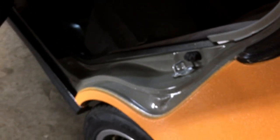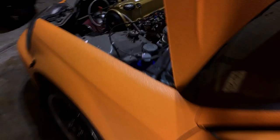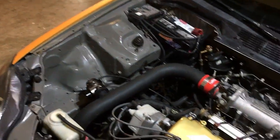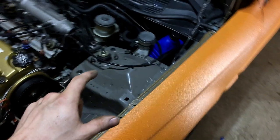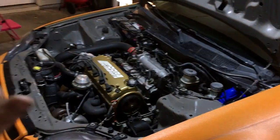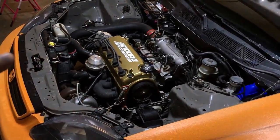All this will be painted along with the door jams — you can see the door jams still need finishing. I'm going to do orange base coat first, just spray can orange base coat on the door jams and then in the engine bay the exact same thing: base coat orange and then bed liner over everything — not the engine. I think I'll take the intake manifold off, move all the lines, keep the engine in and paint the bay. That'll be the easiest route and it still looks good.